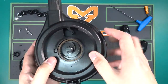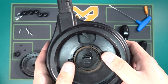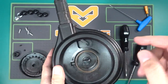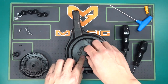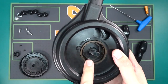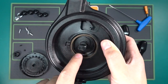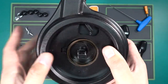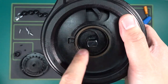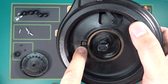You'll notice there's a little bit of oil here. This is a steel spring, so you do need to oil it regularly — just a couple of dabs of SOS oil in here will do the trick. If for whatever reason you damage or break the clock spring you've got to replace it. Make sure you wear gloves when you install it because it's very sharp — you don't want to cut your fingers. It has two little cut-outs: one end connects to the pivot arm, the other end connects to the body.